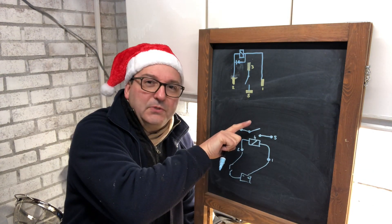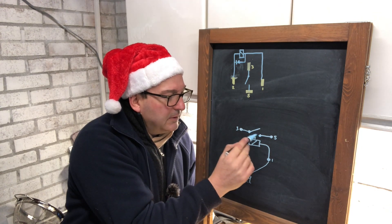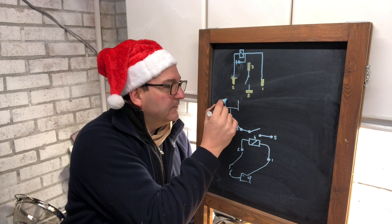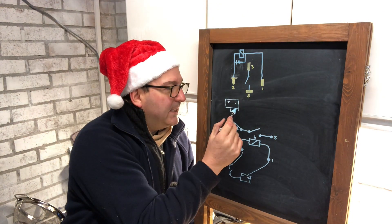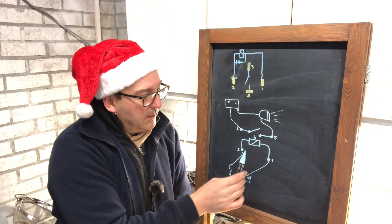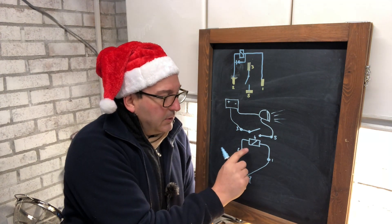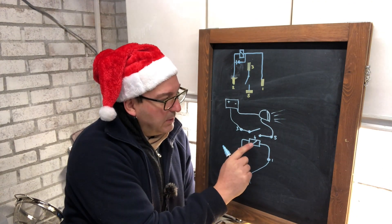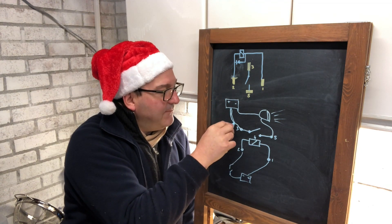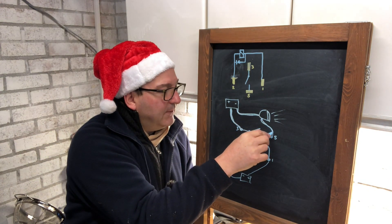Because it's magnetic, it causes a big heavy switch to be attracted down and close the circuit. That circuit, via a battery, could be connected to your big spotlights on the front of your car. So if you connect a low current using delicate wiring to pins one and two, when you energize the coil you close a heavy switch that is served by really heavy wires, because it's going to take a lot of current to complete the circuit that turns on your spotlights.